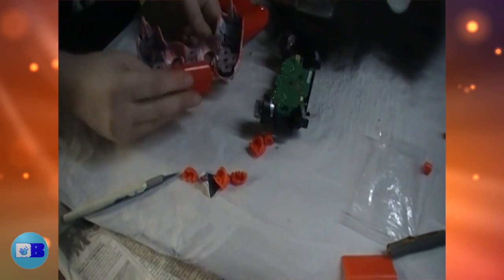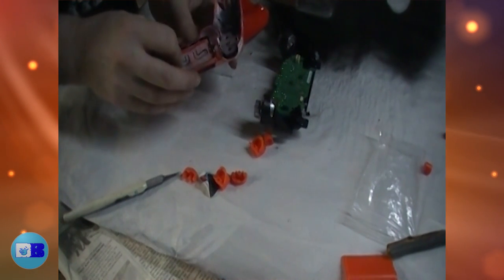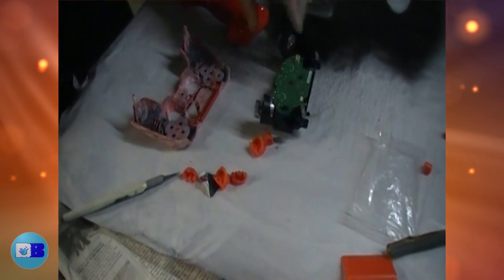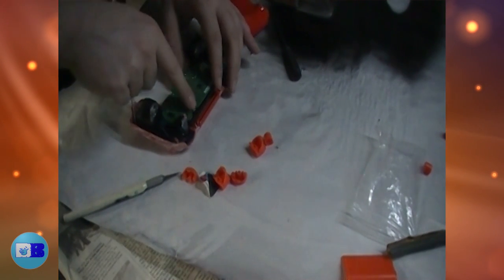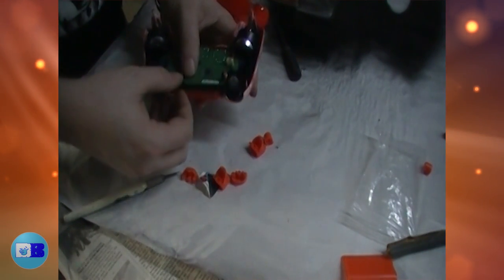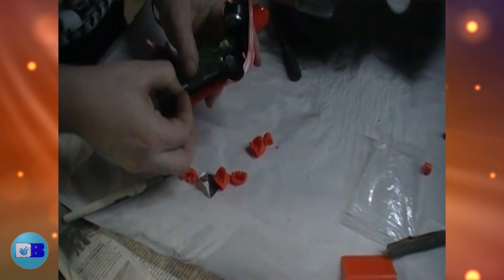Now it is time to put our touchpad back into place, and we want to make sure to hold the ribbon cable down flat against it before we put it into place. You just hook it onto that little bar that fits across there. I mean, you saw where it came from. That's how it goes back in. And then when you're putting the controller back down, there's a little hole there that that ribbon cable fits through in order to attach back to the board where we disconnected it before.